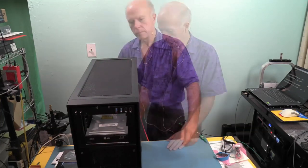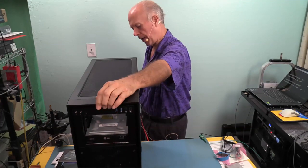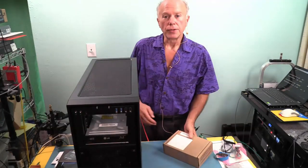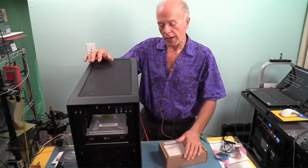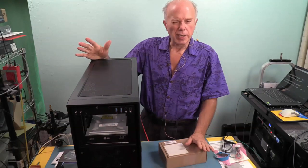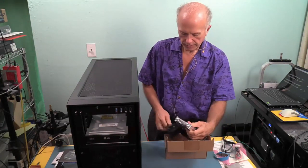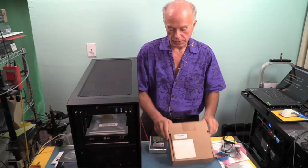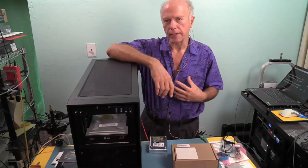We're going to shut it down, turn off the power, hit the power button to make sure it's drained. Power is drained out. Now we're going to get our drive in - on this machine for the secondary drive, we're going to put in a four terabyte. On the X399 machines we used two terabytes for the secondary drive, and the tertiary drive for video data was usually six terabytes or up. So this is a big step going to a four terabyte, but it's natural progression. If you're going to buy a spinning drive, you can look at the Backblaze stats and see which drives are the most successful - those are probably the HGST drives, which run quiet.